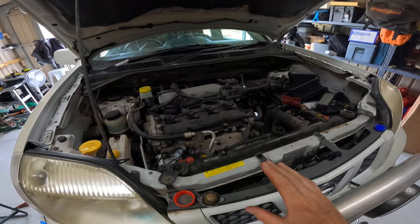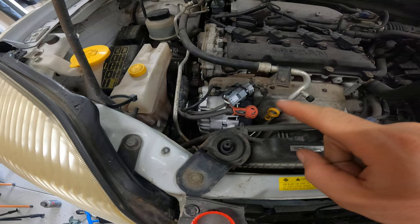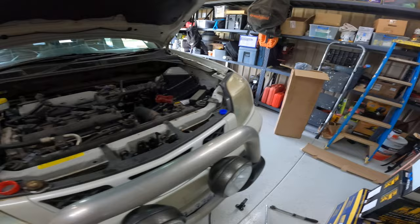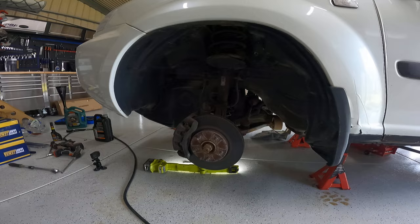And it looked schmick inside. Mechanically, also not doing so great. So I've got a head to do on this. It's mixing coolant with oil and I've determined it to be the head. The alternator had failed, it wasn't charging, so I've put a new alternator on now. There will be a video on that. There will also be a video based on this. I'm going to do a big end and conrod bearing roll as well, as they are more than likely going to be worn, and probably a set of rings as it's done 260,000 k's while the head's off.